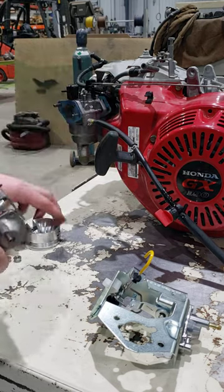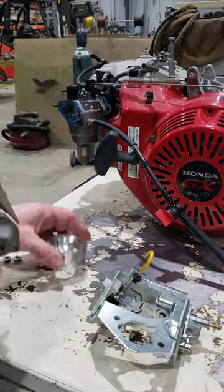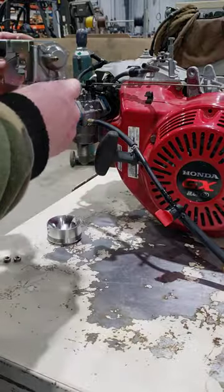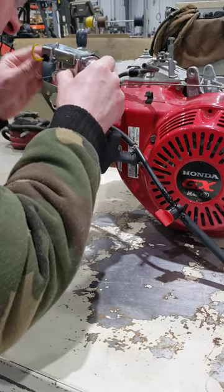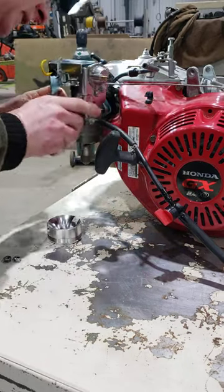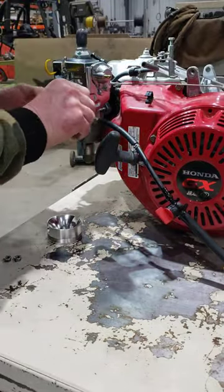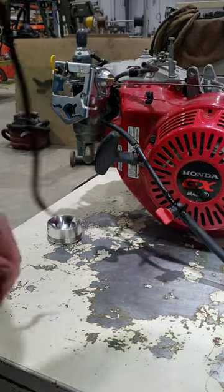During the modifications of the engine, I'm using this adapter, because we're going to put in a different air cleaner. The studs became too short here because of the auto choke module, so we had to cut them and extend them, because we also still have to put a gasket in here. I'll put my headlight on. So we got to extend this in like that, and then onto these posts. Like that. We're still in.